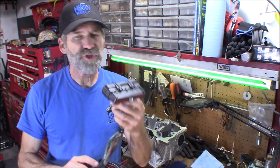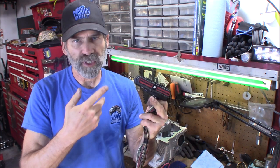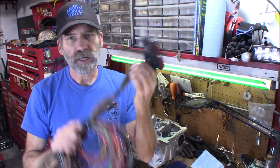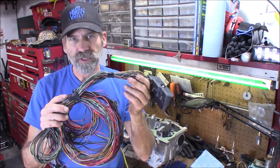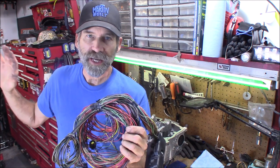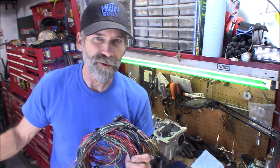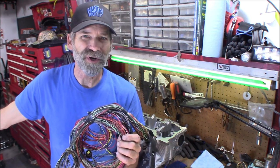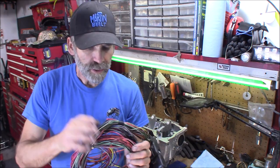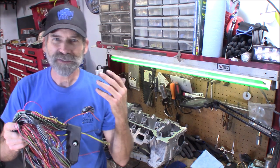There's something I wanted to show you — just in case you wanted to do it the way I did it, where I literally got a section of wire from Pick-A-Part, plugged it into the connector, and had that nice long lead to work with. What I've got here is a wiring harness for the transmission control. I'm actually doing a wire tuck, and I'm going to make that TCM/TCU disappear — I mean it'll still be there, you just won't see it when you lift the hood anymore. All the wires on the right side of the engine bay will be gone too.